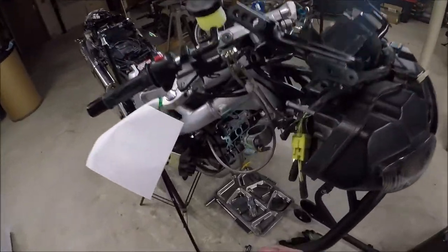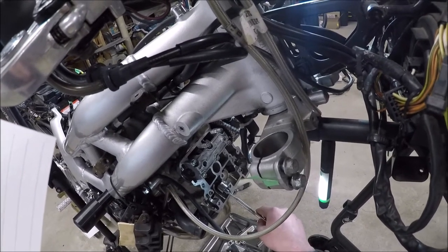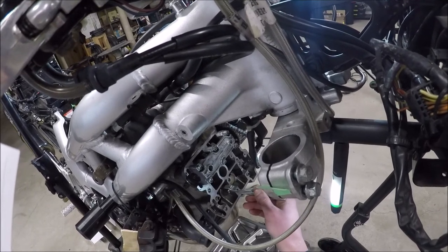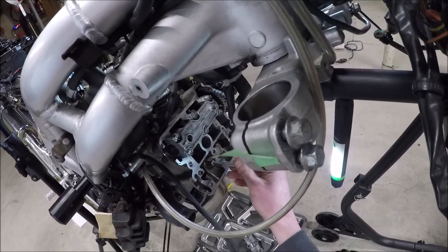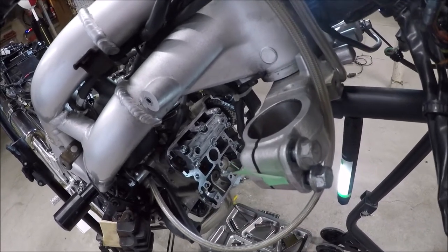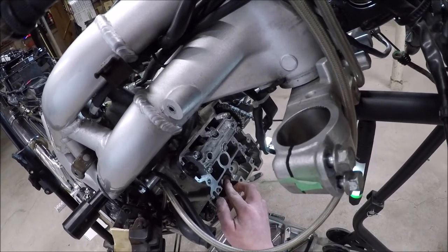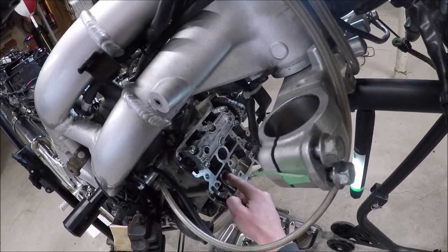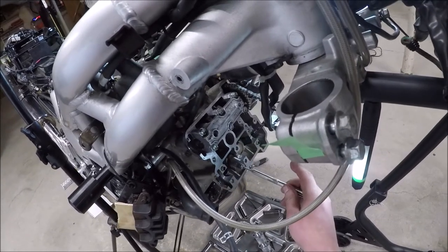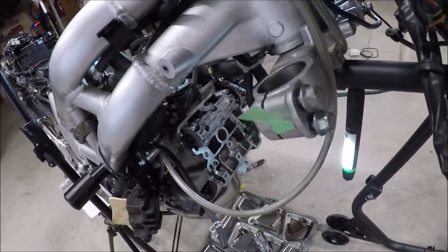And I'm going to be, before I roll this thing over, putting new oil, just rubbing the cam surfaces. You just want to make sure you've got oil on all those surfaces. You don't want any metal on metal contact. I can see that didn't line up correct. There's a lip right there. That didn't line up correct. And there it is. That's like basically flush. Okay, because that presses into it. That's better. All right, we adjusted one of them. Now I can adjust this one. This is the same measurement. If we have the exact same shim coming out, if we got a 1.75, we just need a 1.70.